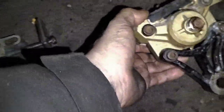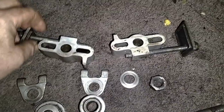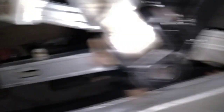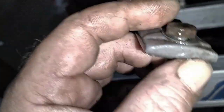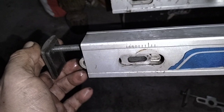Here are all your components: your brake caliper with your carrier, that has to go on. These blocks slide up into the swing arm — they're just for your chain. They sit on the frame underneath so you can level them up. I have them covered in WD-40 just to stop them corroding. The little cap sits in there so when you're adjusting it, here goes — a second one down. Sitting nice, operating nice and smooth.